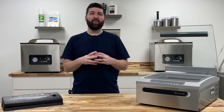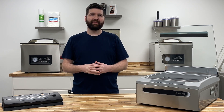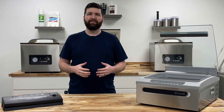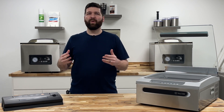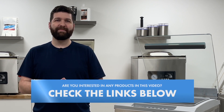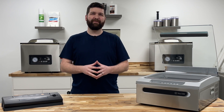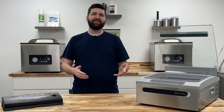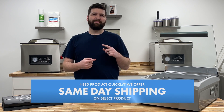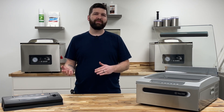In an oil lubricated rotary vane vacuum pump, these were designed to require regular maintenance, which in turn provides a longer lifespan for your chamber vacuum sealer. When moisture enters an oil pump it mixes with the oil, and when the oil reaches a certain temperature the oil and water separate — the moisture is then expelled through the exhaust. This promotes an almost moisture-free pump with a much longer lifespan. To maintain it, run your routine cleanup program on a Vac 100 and make sure you're doing routine oil changes.